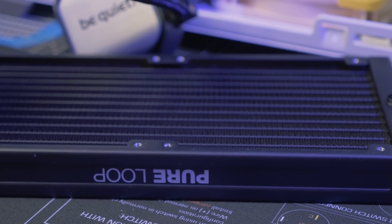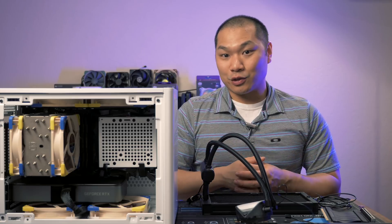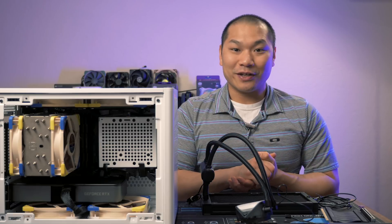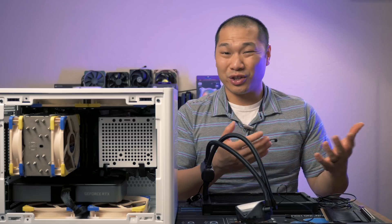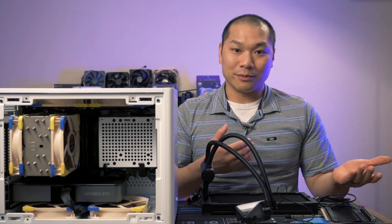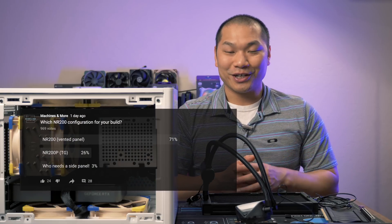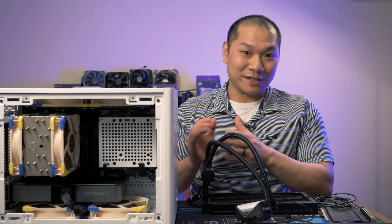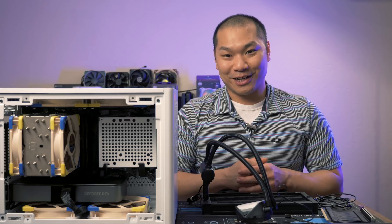I think Cooler Master made a pretty good decision by giving users both options. If you've got the glass panel and want to use the vented panel, it's pretty easy to switch back and forth. I also tested the vented panel with the vertical GPU, and the gap was similar to the gap between the vented and tempered glass panel in the horizontal configuration — about 1 degree or so. One possibility: go for the NR200P, run the tempered glass for non-intensive activities, and when you settle in for extended rendering or long gaming sessions, just slap the vented panel on. Judging by the poll results, most viewers are going with the vented panel, and that configuration — along with something like the Noctua C14S or the U12A — would be my personal pick as well. I hope you've enjoyed the comparison today, found this helpful, and I've left links below for some build components. Happy building, and I'll see you in the next video.